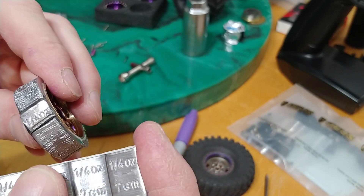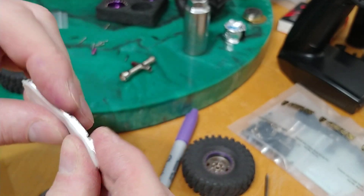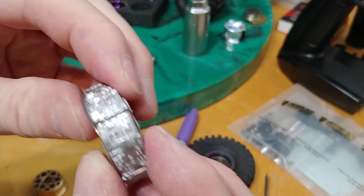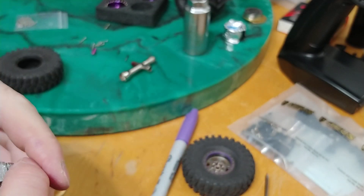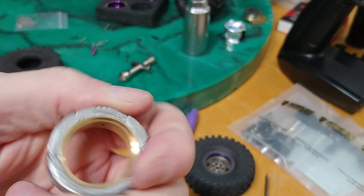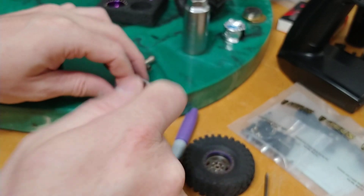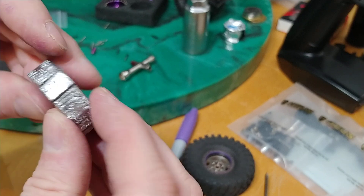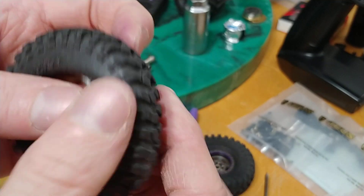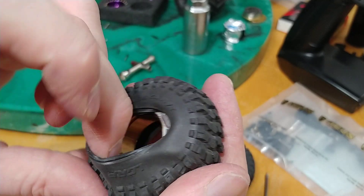These larger segments are crazy wide — I can use a whole segment without cutting. I just took a hammer and laid it on its side to hammer down the sharp edge of the lead so it won't rip the tire when I mount it. The outside is totally smooth despite the plier grip marks on the inside — it's fantastic. If you do have a problem, just put it on something hard and smack the edge around and you'll end up with a really nice smooth edge.